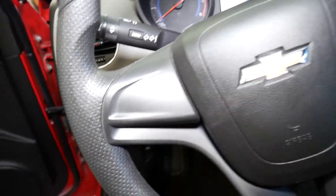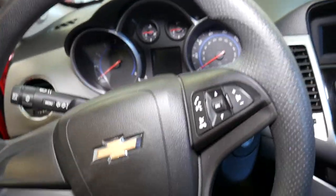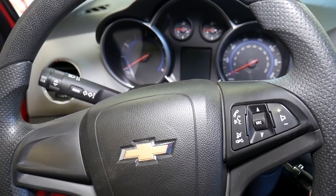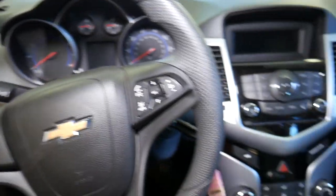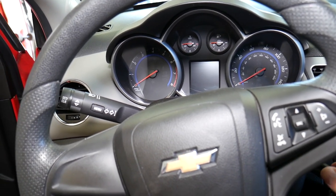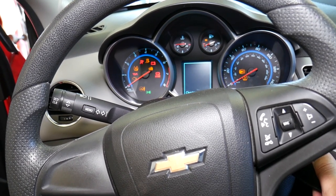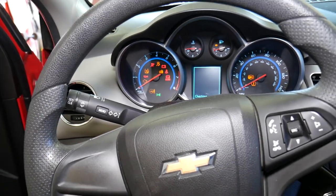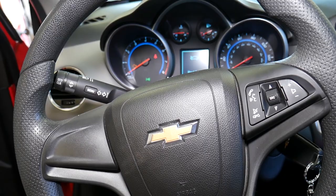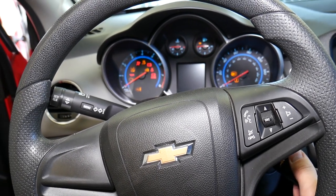On most vehicles it's super simple to hear your pump running, but on some General Motors vehicles you cannot do that as easily. On most cars, if you turn the ignition on, for the first second or two you're going to hear the fuel pump behind the rear seat — where the fuel tank is — making a noise, then it stops immediately. On Chevy specifically, once it builds pressure and the fuel pressure sensor reads that, the pump will not turn on again and it can sound like a bad pump.